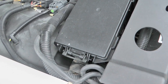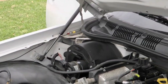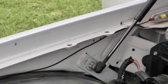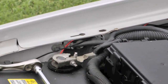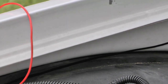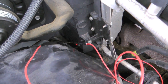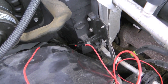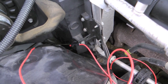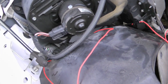My conduit is at the shop and I'm at home today — same with my fish sticks. So I had to use a coat hanger, poked it through there, taped it to the wire, and will pull it through to the passenger cabin through the factory boot. I ran the ground to the factory ground location right there. It's usually wise to use the factory ground locations, because you may not get a very good ground if you just self-tap it. I didn't want to mess with the battery ground itself since that needs to be well connected. Now it's just run the hot wire.